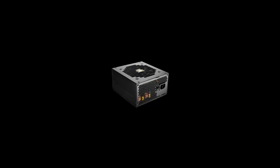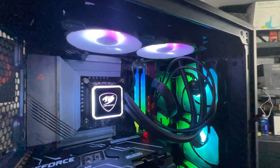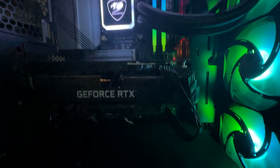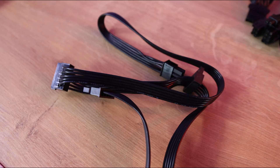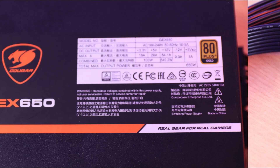In testing, all voltages and wattages performed as expected with no issues. We powered an i7-12700K and a GeForce RTX 3070 simultaneously, drawing around 600 watts from the wall without any problems. That said, I wouldn't normally recommend running a PSU close to its limit — it becomes inefficient and causes wear. I always recommend leaving around 20% headroom, and bear in mind that power spikes near the limit can cause crashes.